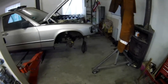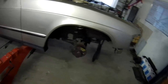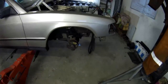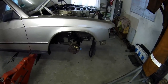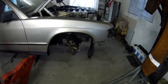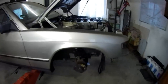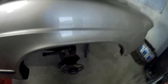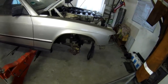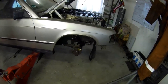So if you want to do a bigger brake setup on a W201, it's the same as a 500E from the W124, which also uses wheel hubs from an S-Class 500. That gets you up to 320 millimeter brakes. This is the same setup I have — it's also on a 320 SL. So if you use the normal versions of an R129 320 or 500, they have bigger brakes and they fit perfectly underneath the W201.